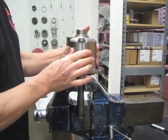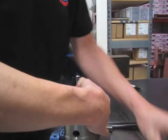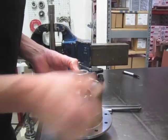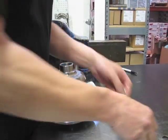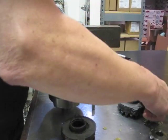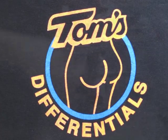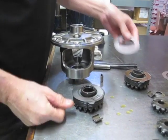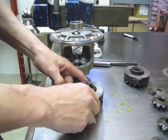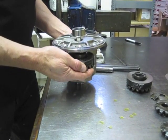I'm going to take this apart. I'll put our 45s up there. And we're going to jump it up just 2.5 thou to show you what that can change. So basically we got a 32 and a half and a 15, so we're at 47 and a half. We've only gone up 2.5 thou. And we do offer the double disc ground shims if you really want to get nitty gritty on a tune-up.